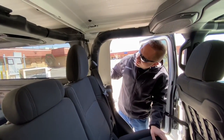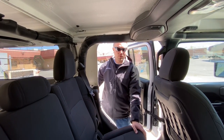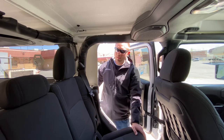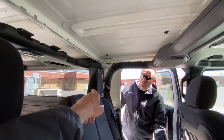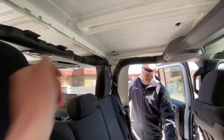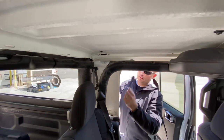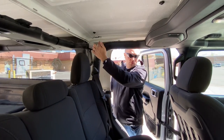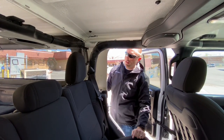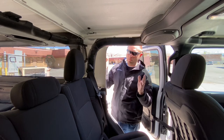As you can see back in the middle row, it's still very standard looking. Not a lot of strange things happening — it's what you'd expect in the back row of a Gladiator. You basically kept the original roll bar and then tied in a second one. That's right. If you look up in here, you see this bracket that runs across the top — it's eighth-inch steel, bent and coming around down the sides as well. This piece is actually much stronger than the original roll cage. If something were to crack or if we rolled over, it's more likely that the OEM cage would bend than this bracket.